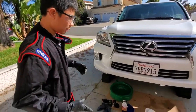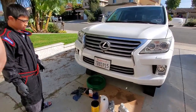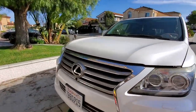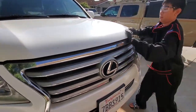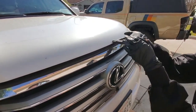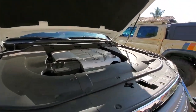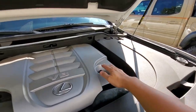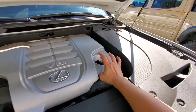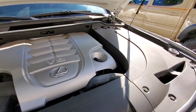Jesse, so you're suited up and ready to go. We went over everything a little bit earlier. Now what we're going to do first is pop the hood open. These have shocks so it's a little bit easier to pop open. There's a little safety latch so it doesn't pop open by accident — you want to move it from left to right and push it up. The oil filler will be right here. We'll loosen the oil cap after we start to drain it — if we do it now it drains faster but ends up being a little bit of a mess.